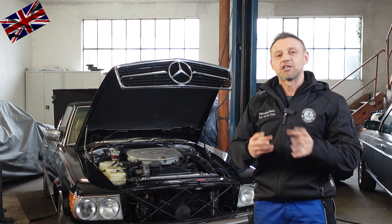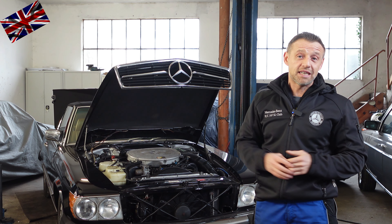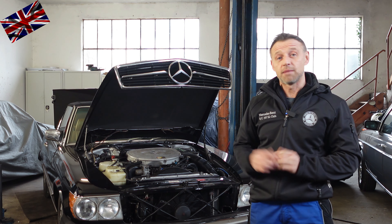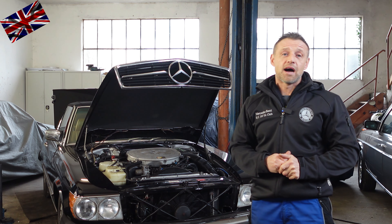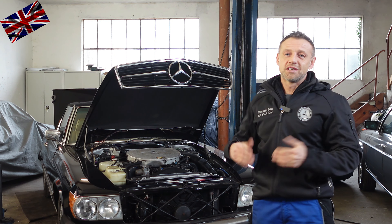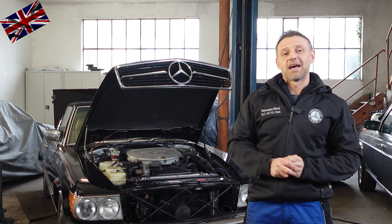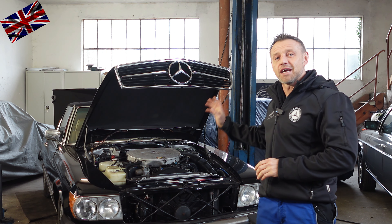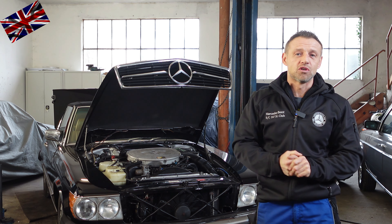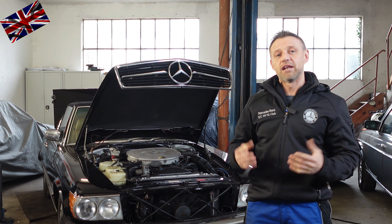Sometimes the system plays tricks on you: the locking mechanism of the doors is working, but the trunk lock and tank door cannot be opened. The schematics can be found in the service booklet that comes with the car, probably buried deep in your glove compartment, or also on the internet under the chapter 'central locking system'.